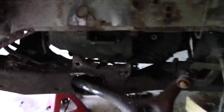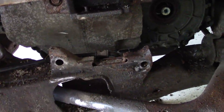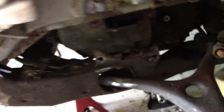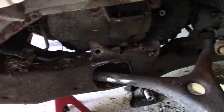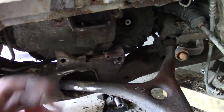Now here's huge news. Looking under here you'll notice something's missing — that's the motor mount. I've taken it completely out of this Sable. Whether you're running the 3.0 Vulcan pushrod engine from the 90s, or this engine here — the Duratec V6 dual overhead cam, the one with two belts — they're all the same motor mount right here, and it's all the same problem. I had this happen with Karen the Killer Compact — that was a 1990 Taurus. From 1986 all the way to 2007, literally over 20 years, Ford has never fixed this motor mount problem.